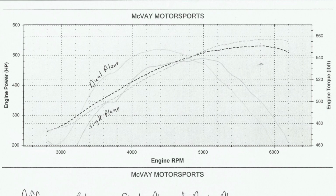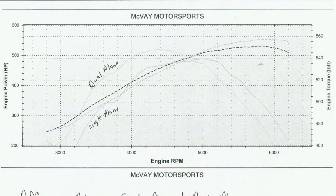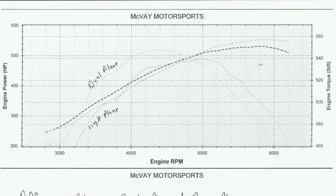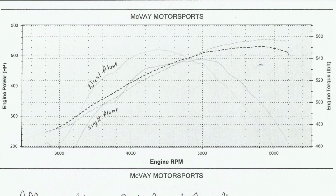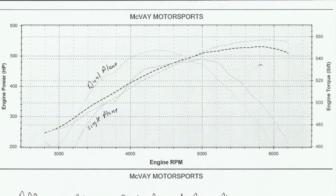I've seen it happen over and over and over. And even though you're like, no, torque wins, not the low RPM torque, not in a drag race. But maybe in a circle track, this would be a different situation. But street driving, that dual plane would feel better. On the actual performance on the track, it's the single plane.